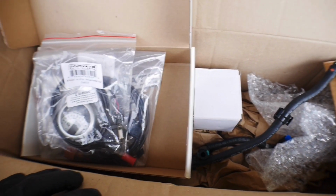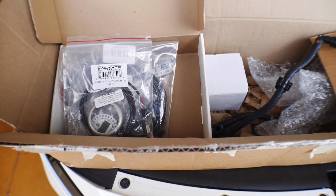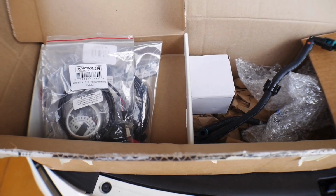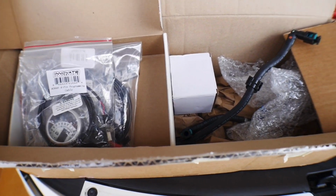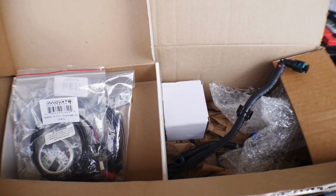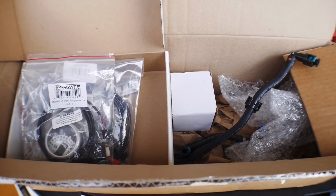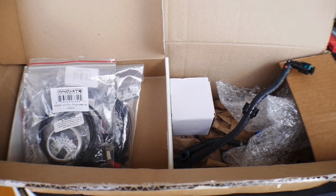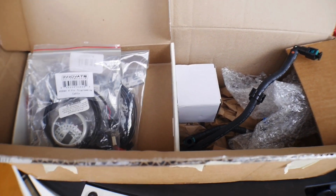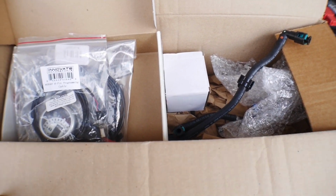So today we're going to go through the process of getting this installed. Keep in mind that when you are running a mixed E85 with gasoline tune on your vehicle, you will need to have the vehicle tuned. Now, this kit does come with its own baseline tune so that you can run a mixture of between E30 and E40. That's a diluted blend of E85 with premium gasoline. Or if you choose to, you can go out and get a custom tune from any one of the local tuners that would be able to tune on this system. So your choice, but mine already comes with it.